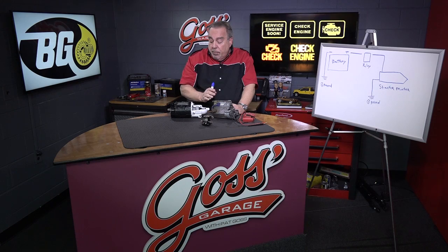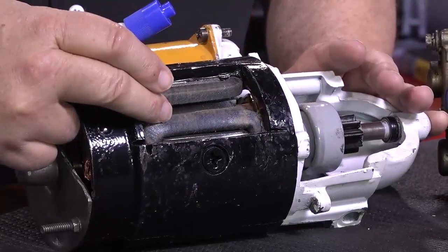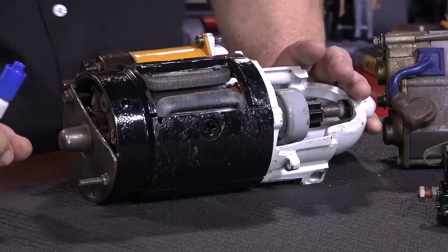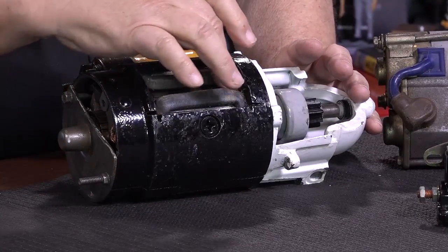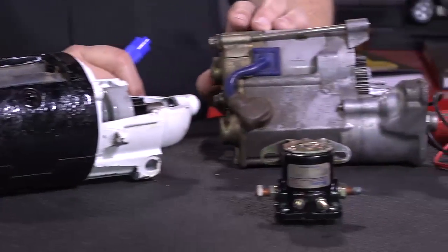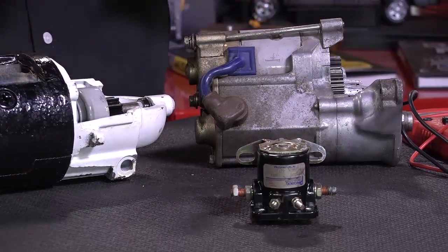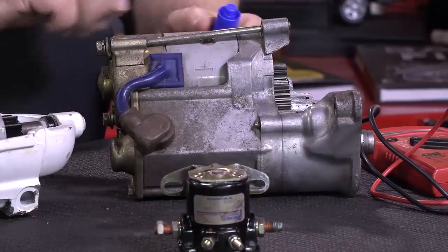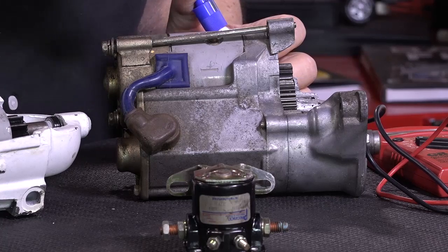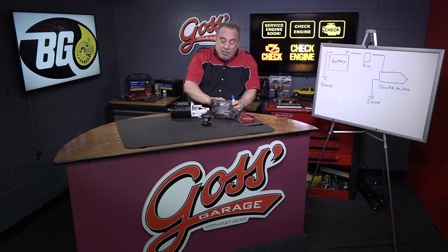A couple of things you have to be aware of. One old trick to get one of these going — one of these old-fashioned ones with the bar-wound field coils — is you could get under the car with a hammer and go bam. Lots of times they would start because there would be a short between some of the metal inside, and you'd knock it loose. But on the permanent magnet starter, don't go beating on that, because permanent magnets can break. If you hit this thing, you may break one of those magnets, and what might have been a minor problem becomes a major problem — you'd have to buy a new starter, and you could be looking at a lot of money.